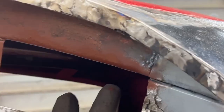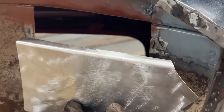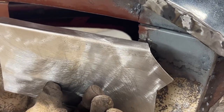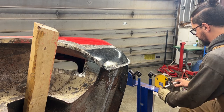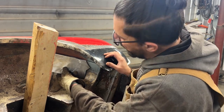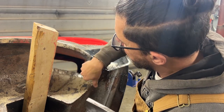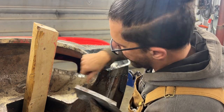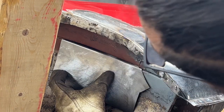So here we cut this piece, cleaned up a little bit around it, cleaned inside, primed it, and I made this piece that we're gonna have to bend — it's gonna go this way, we have to stretch the flange so we can give it the same curve, and then somehow we're gonna put it inside and mark it on the outside. I can't work very well from inside, so I'm gonna shorten the flange to the correct length so I can put the piece on this side and compare the curves. I cut the flange — let's see if it's gonna fit. Oh yeah, we need to curve it more.